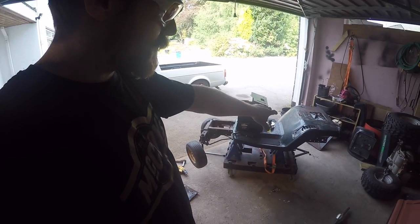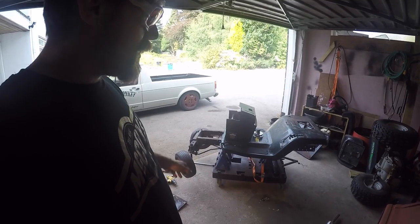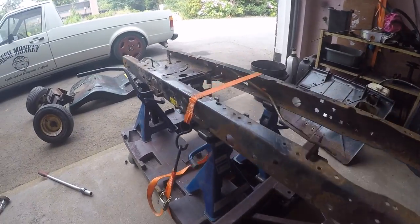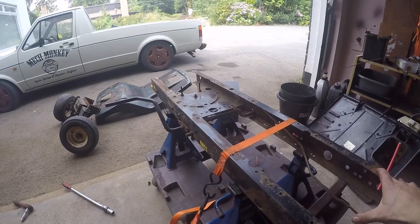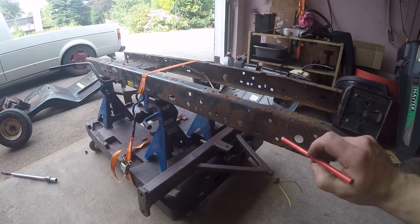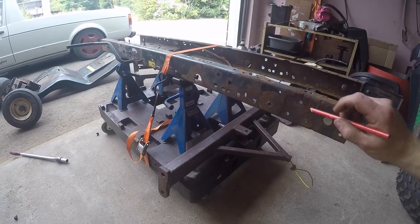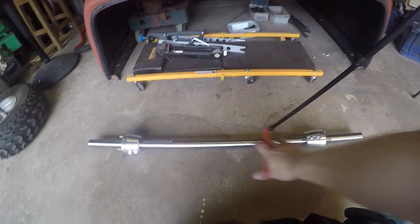First things first, we're going to take the back off and rip the front axle off altogether, strip it down to the two bare chassis rails, and start doing some prep work and welding. Here's the chassis stripped down — there's still a centre brace holding the two chassis legs together, which we'll leave for now. These three bolts here were where the original trans-axle mounted. I want to put this go-kart rear axle here, but it needs to be right in the centre.